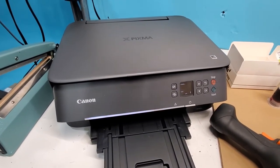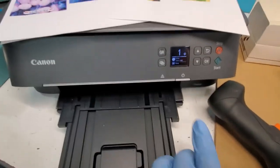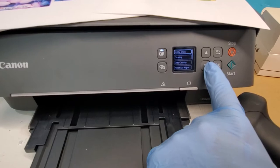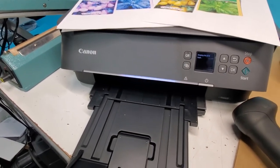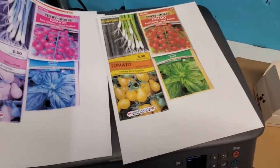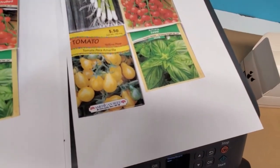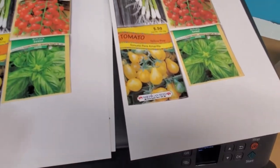We're back to the correct color. It's also recommended to run a quick clean print head, so we're going to go to maintenance, cleaning, and do one cleaning — it'll take a couple minutes. Even though you can see it's already much better and back to its original color, it's recommended after each refill. This is the first one I did with the original Canon ink that was not refilled — now we've refilled it and all our colors are showing. There's red, there's yellow, black we didn't refill, but all three colors that are supposed to show are showing.